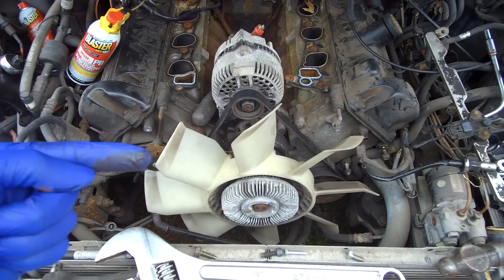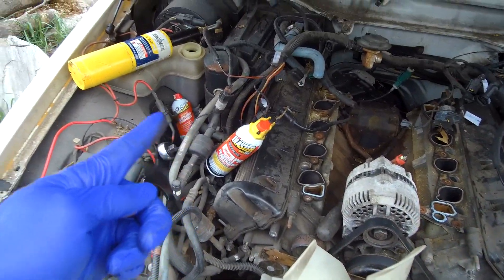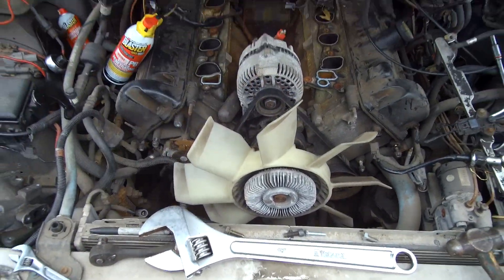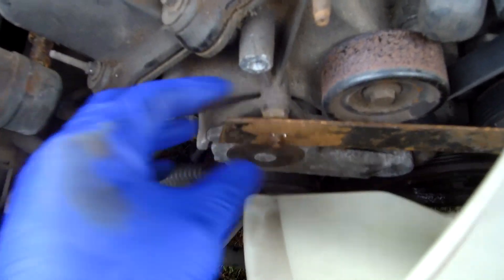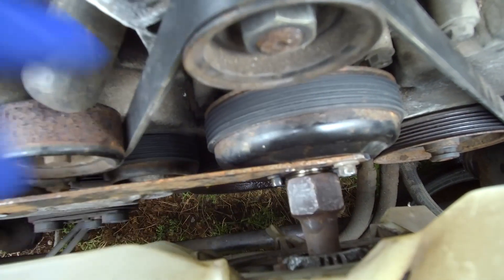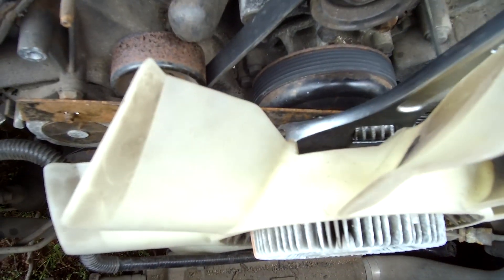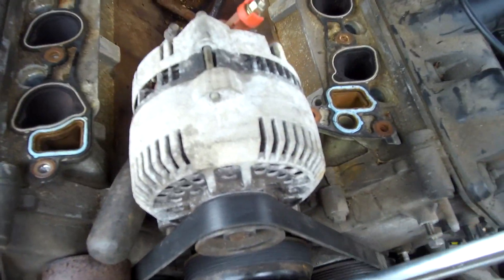Behind the scenes - you guys never told me how hard it is to take off this fan. I used PB Blaster, torch heat, soaked it, and then didn't have a proper tool. But this wrench does fit over that little nut, so I found a piece of iron, drilled a hole in it so it could fit right into this section, ran another hole there, and the nut started to come out - which was very surprising. That's how you do it.